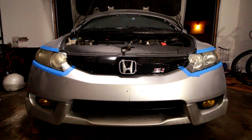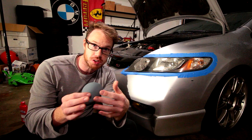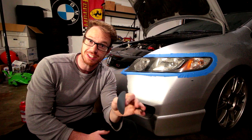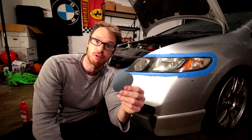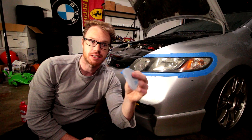Included in this kit are three different grits of sandpaper: P800, P1500, and P3000. The lower the number, the coarser or rougher the sandpaper is. Interestingly, though it includes the 800, the instructions actually say to forgo that unless your headlights are absolutely hammered — you'd actually just use the 1500 for this next step of knocking out the haze. That 800 is really for headlights with heavy pitting and damage in the surface. So we're going to attach the 1500 grit sandpaper to the polishing attachment and do some wet sanding.